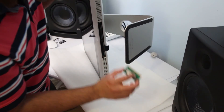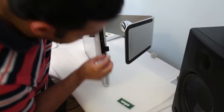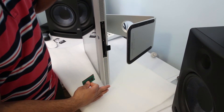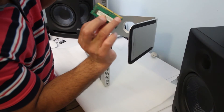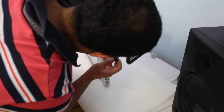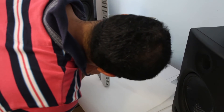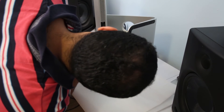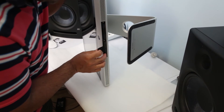The RAM module has two sections — it's notched in between, with a smaller end and a larger end. With the Mac vertical in this orientation, the smaller end goes on the bottom. Get the plastic out of the way, insert the RAM gently, don't apply too much force, and that's it — the RAM module is inserted.